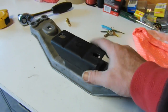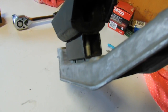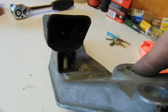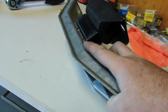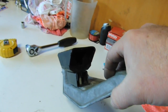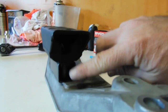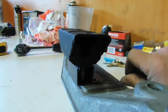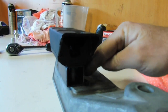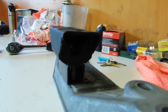Okay, I've bolted that mount on there and it's still super rock solid. And there's probably no real problem with the strength of it, but I don't really like how that back edge of that box sits off that lip a little bit. I'd much prefer that edge to be supported. So, you know, it's probably going to be strong enough, but what I'll probably do in future is get, say, 2 pieces of 30x30, say 3 or 4 mil thick wall box, put them next to each other, out of aluminium and actually TIG weld it to the base here.